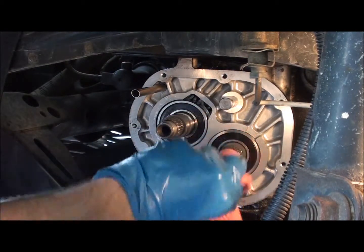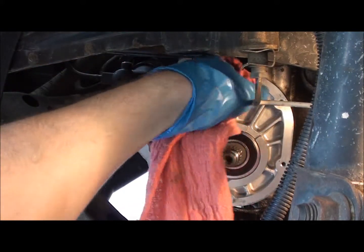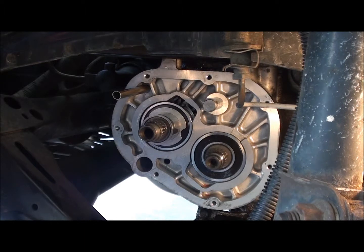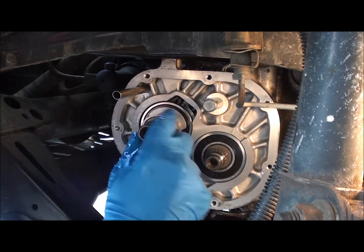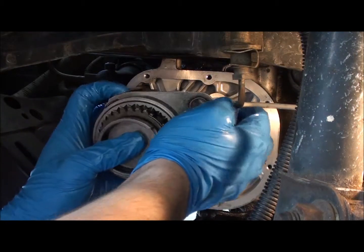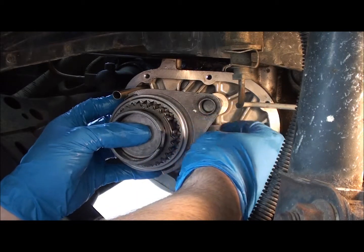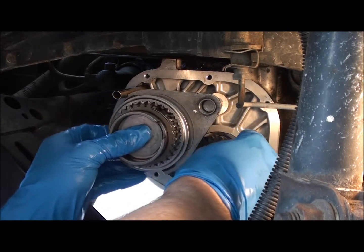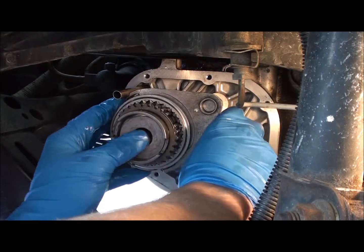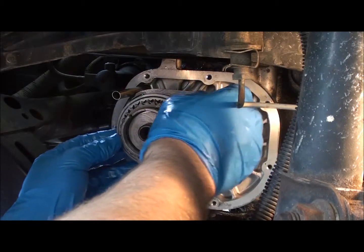I'm going to do both of them and it looks like we are ready to install those new gears. There is an inner race that I've pre-installed along with that spacer in the back. I'll go ahead and put those on there because it will probably make it a little easier to get the big gear on. Go ahead and install this, set it up in there, try to line everything up. Then just turn until that one splines - until everything matches up and it should just push all the way back in. New gears are installed, mostly.